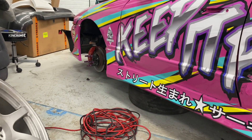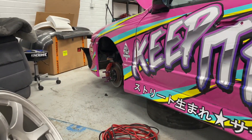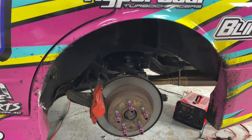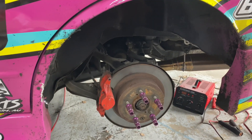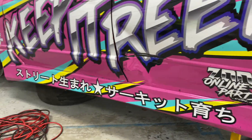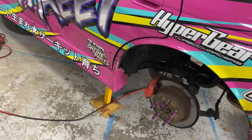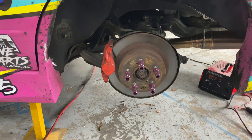With a good damping setup and settings it still has like 20mm of travel. The rear is more dialed in on damping settings so the damper works harder than the spring kind of deal, which keeps it stiffer and sitting level when you're throwing it around. It ends up handling a bit more like a go-kart but still has that squat, grip, and bite to the ground when you get the wheel spinning.